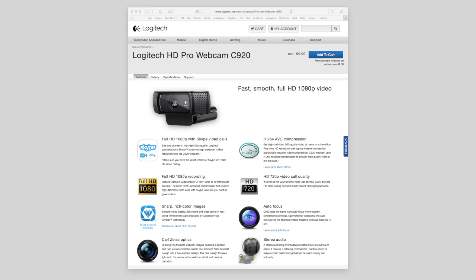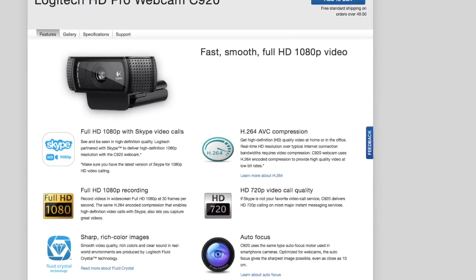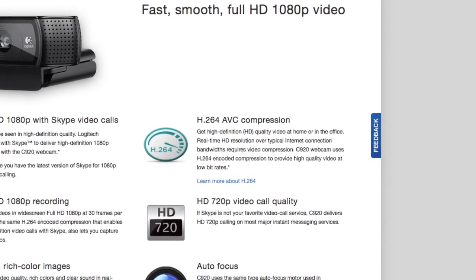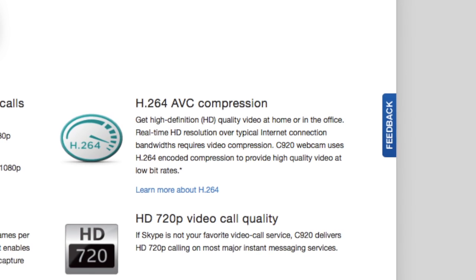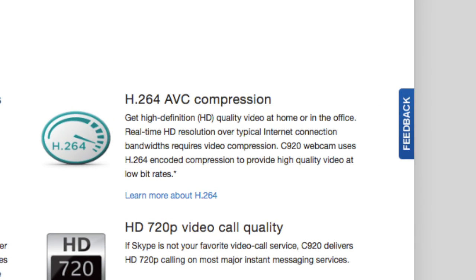That's why a camera built into your Mac usually works a lot better for HD. However, what the C920 does is instead of piping full raw video over the cable, it compresses it first in the camera to H.264, which is kind of the native format for QuickTime and for use in Final Cut and iMovie. So it is compressing on the camera and sending the compressed stream over USB 2, meaning you can get 1080p video even though it is a USB 2 peripheral.